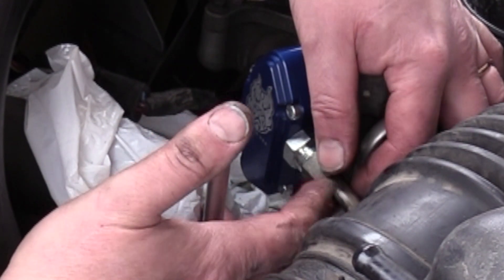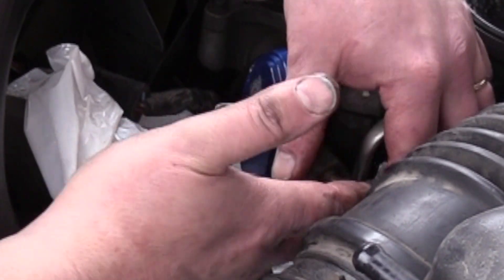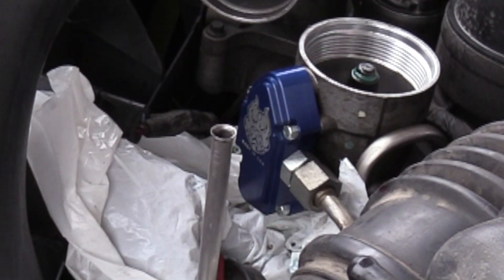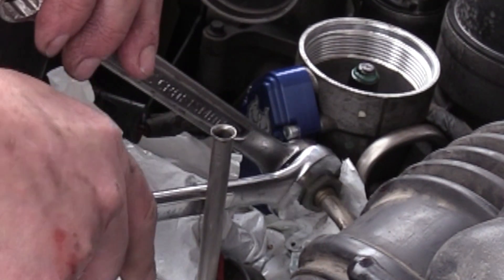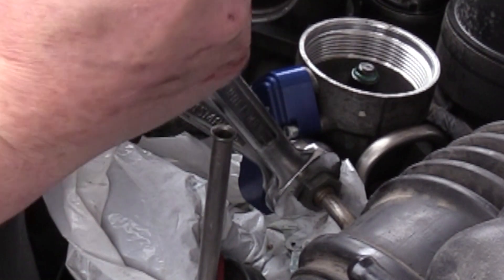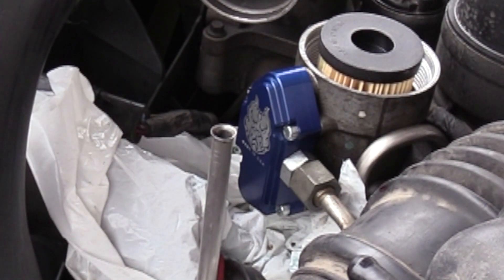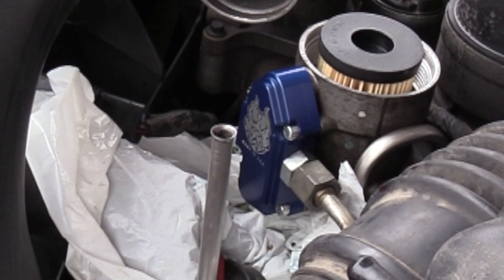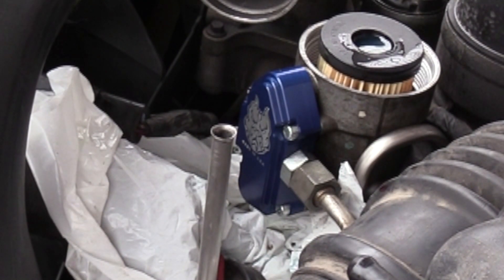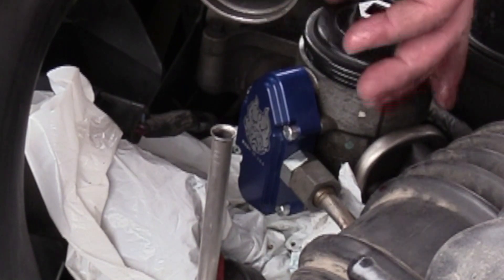Notice the red magnetic strip securing the hardware. It's really important to hand-start any tubing B-nuts to prevent them from being cross-threaded. Here I'm using a backing wrench to support the fitting and prevent it from stripping the aluminum housing, using rubber bands because of the quality of the components. I set the old fuel filter in the cap to collect some fuel, which is then used to lubricate the O-ring on the cap.